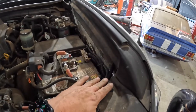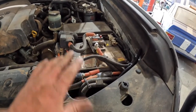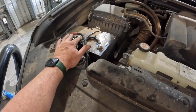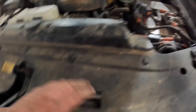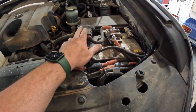The wiring for the light bar connects up to the existing wiring for the spotlights here and I've adjusted the fuse accordingly — that's gone up to a 30 from a 20. The other wiring comes all the way across and hooks up to the second battery. I've used a 10 amp fuse at this stage; I'm assuming it'll be closer to 7.5 once I get all the lights on, but we'll leave it as a 10 for now until I measure it. There's the winch circuit breaker and a couple of circuit breakers for the dual battery and the BCDC which is mounted down here.